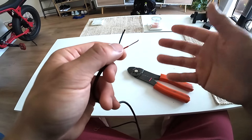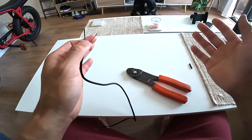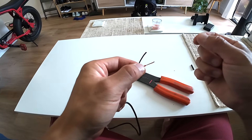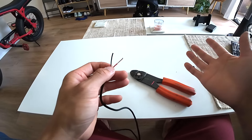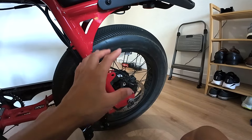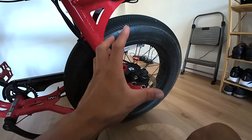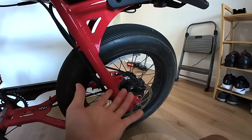I literally just twist and electrical tape, and it might sound scary but I promise you it's not, because what we're doing with these wires is very low voltage. Do not do the twist and electrical tape method on things that have to do with your battery, charger, or phase wires, because those need to be soldered since they're running a lot of current. But these tiny little wires it's fine. I always do the twist and tape method for my lighting system or switches. We're going to use that method for our three-speed switch, throttle, and e-brake function — engaging regen when you hit the brake levers. So for this build we're going to be going with a five kilowatt motor because if we want to go insanely fast it needs to handle heat build up, which a five kilowatt will do much better than a three kilowatt motor.